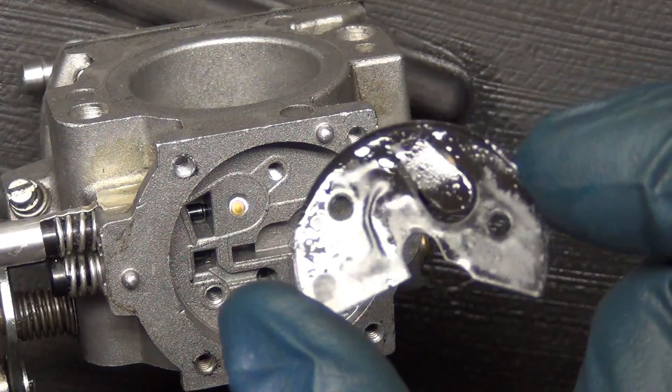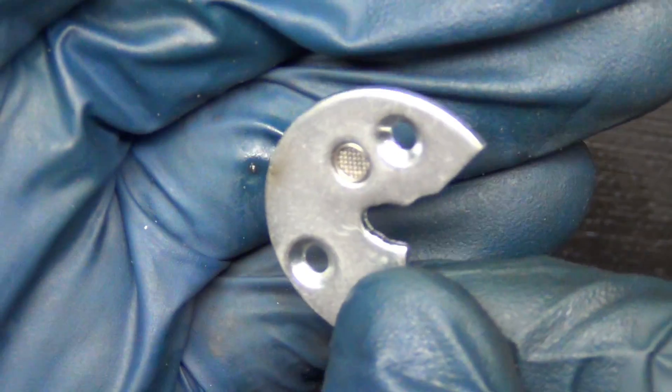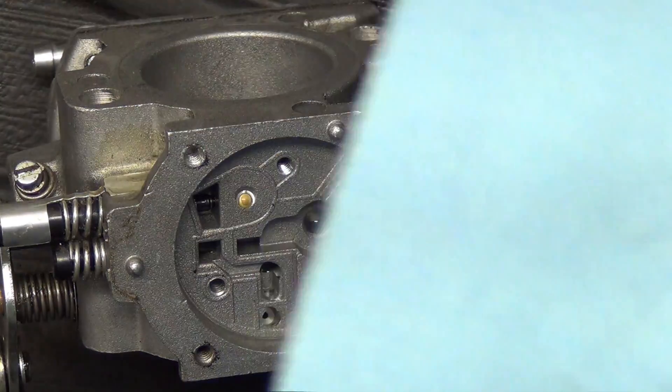With that screen there, you should be able to clean it from both sides without having to replace it. I'm going to match this to the one that I need and lay it out. These little screens — it's a good idea to replace them if they need it, but if they don't, just leave them alone. That's clear — that's why it's nice having an inline fuel filter. You can catch all the junk before it gets to your carburetor and still be able to get fuel so you don't have some kind of engine-out issue.